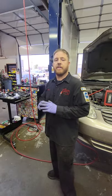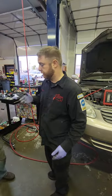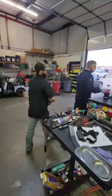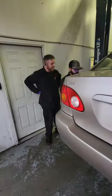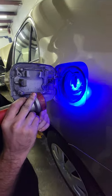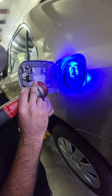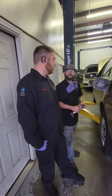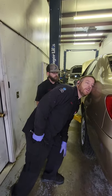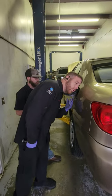If it's a really small leak, an incandescent bulb is the best way to find it. LED lights are a little more difficult to find leaks with. The black lights and blue lights do really well for leaks — we're using that. If there is a really small leak, you can hear it sometimes too — put your ear against it, you can hear air and gas gushing out. And you can smell it sometimes. No noise and no smell here, so let's see what else we've got going on.